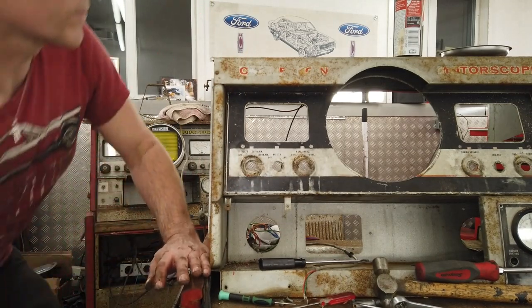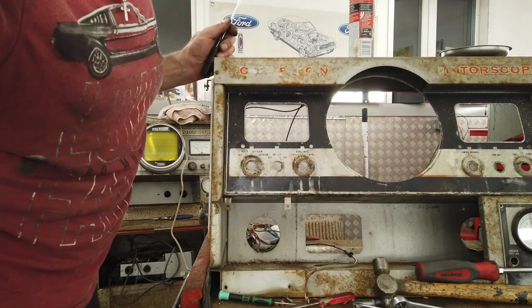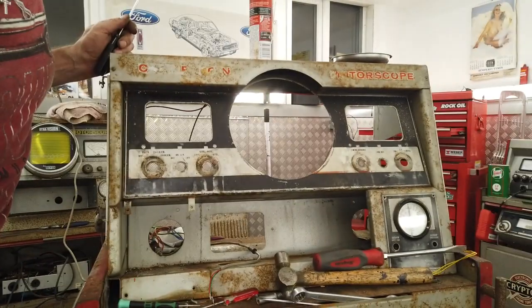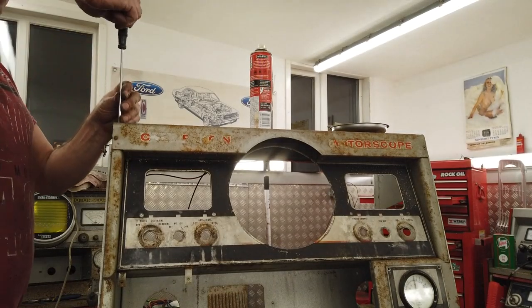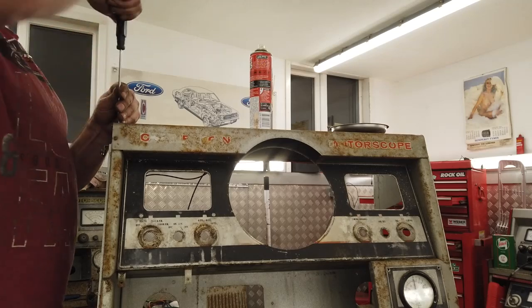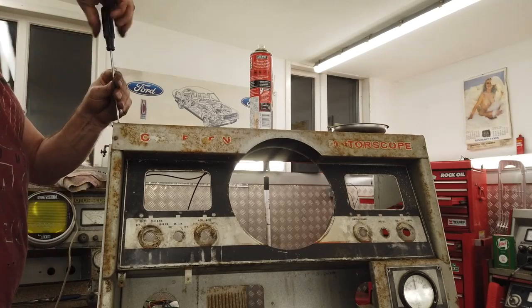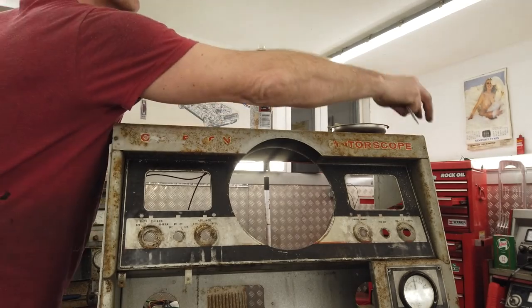So that leaves us with the top plate to come off. It should come off quite easy. I'm going to tilt you up a little bit. Hold on. Left to right for you. And now flick the switch and up we go. Just a touch so you can see this come off. There should be some lamps inside this because this has lovely little incandescent bulbs that light the gauges up. They'll be on the harness, so we'll have to disconnect the harness.